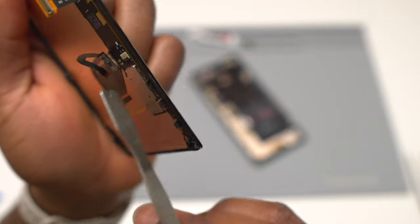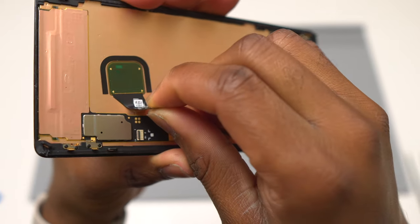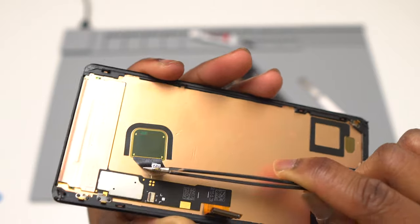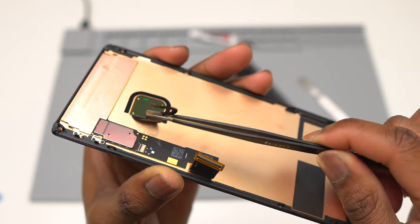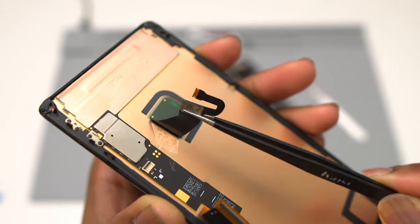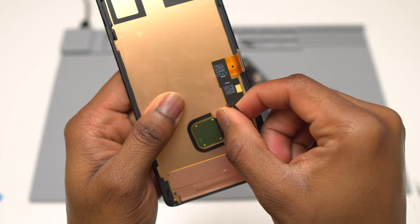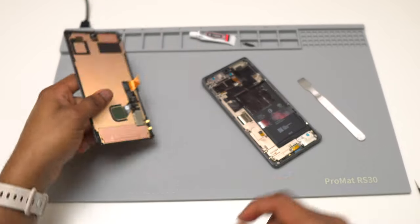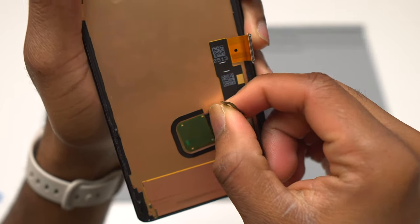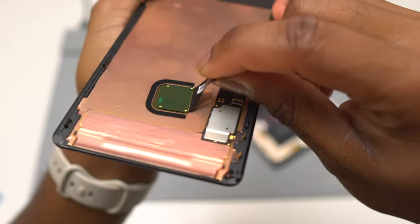Use a flat metal tool to go under the fingerprint sensor flex cable and the screen, then push toward the end where the fingerprint sensor is. I decided to stop using the metal tool and pull by hand to avoid it getting too close to the fingerprint sensor. Make sure you do not pull hard all the way to the sensor — you might crack it. When I knew all the flex cables were disconnected from the screen, I grabbed the flex cable by hand and pulled it right and left, not directly toward me but horizontally. This is the best way to remove it without damage.